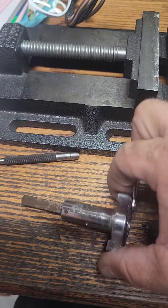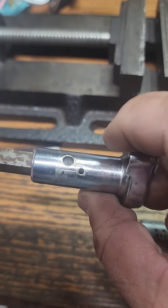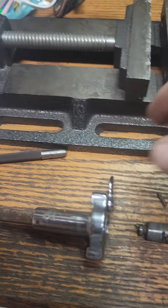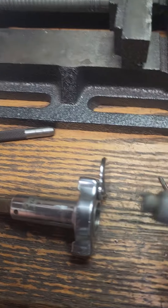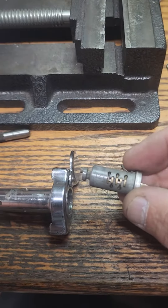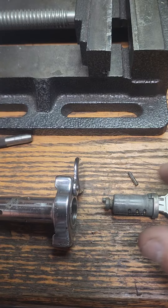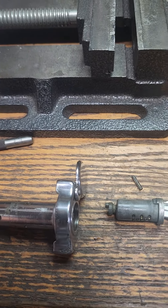On this particular trunk lock, if you already have it out, there's a roll pin that goes right on the side there. You tap that roll pin out with a punch, you slide the lock right out, and the key code is stamped right on the plug. This says 127 right there, so you're going to use FT-127 or FS-127, and you're going to get the cuts. And there you have it from the generic code 12231.